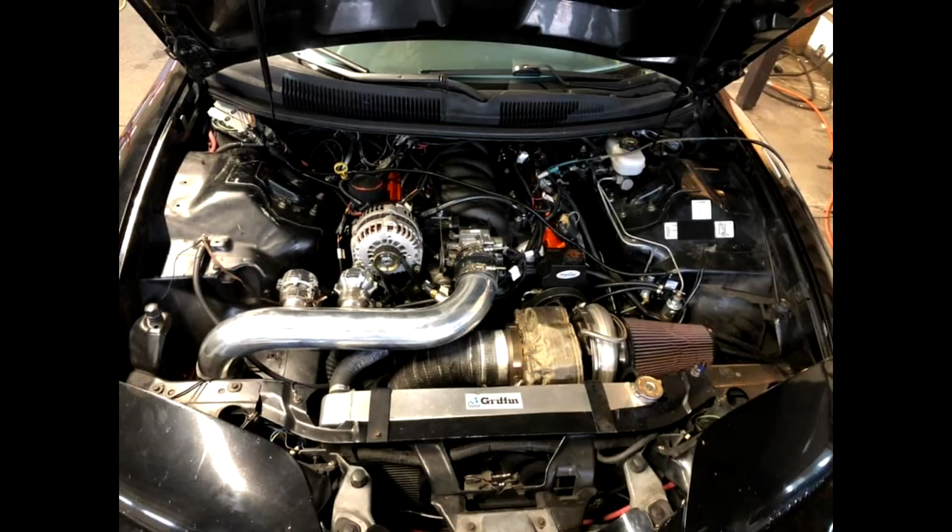The only difficulty here is this car has twin 450s, and he has it set up, to my knowledge, after talking with him, to the best of its abilities. It has a 10-gauge wire for each pump. It has a separate 40-amp relay for each pump, and I think he's running it straight off the alternator or battery. But we just were running out of fuel in like the low 20-pound range, and we just rolled the dice for fun on the dyno to see what kind of power it was capable of at higher boost.